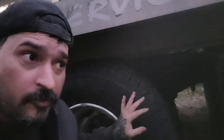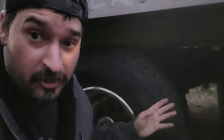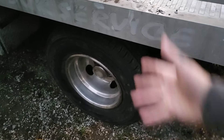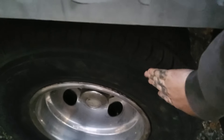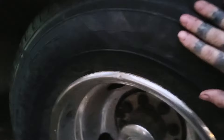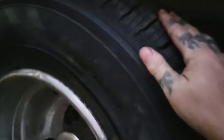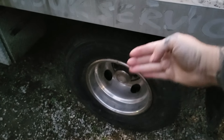These are Patriot HT load E tires, 10-ply. They're good tires. If you've never tried them and you got a heavy-duty work truck — even if it ain't a dually — I recommend these Patriot tires. They're not the cheapest tire, but they're also not the most expensive. They're such a good tire that they are hard to find in stock. They ride good and they got a thicker sidewall than a normal tire, which I really like. Just so you know, when you put these on a dually with a full heavy load, they might try to touch a little because of that bigger sidewall.